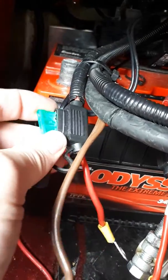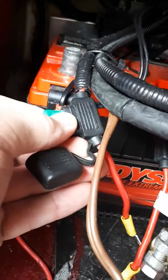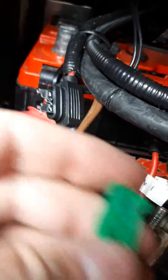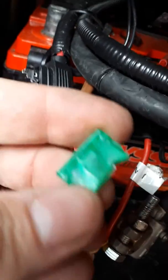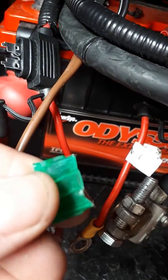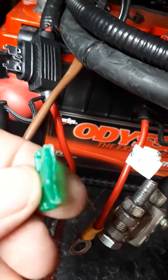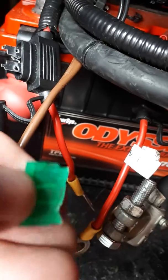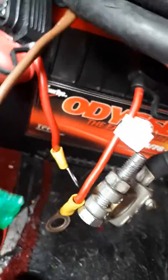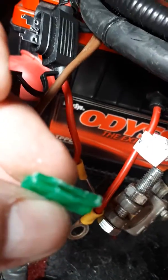That's definitely not loose. We've had some melting here by the look of it — looks like that cover has seen some action. That's definitely been melting, so the fuse has definitely been shorting across there, obviously not functioning as a fuse. Classic Lloyd's dog shit. Thanks for watching.